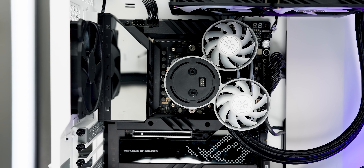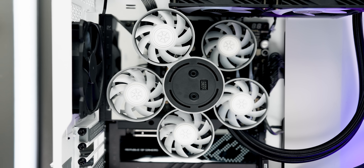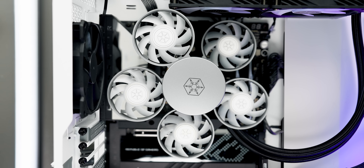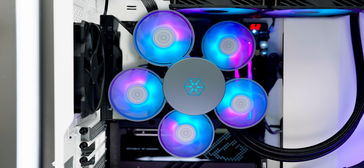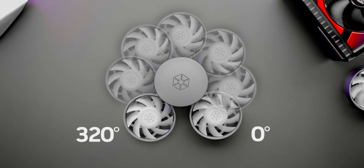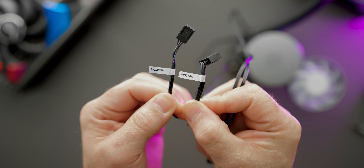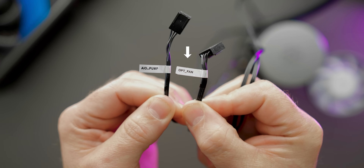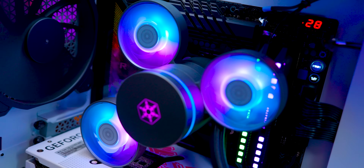You just pop off the top, a tab system guides the pogo pins into place, and a pair of snap rivets secure everything. Subsequent fans slot onto the top the same way, and it's all capped off once again by the pump head cover. They also allow for 320 degrees of rotation to get coverage over whatever area you want. Controlling them though, that's another matter. Silverstone recommends that you plug them into the CPU optional header, so they run in sync with the main AIO fans.